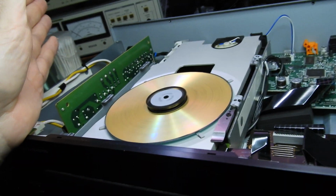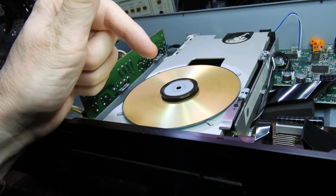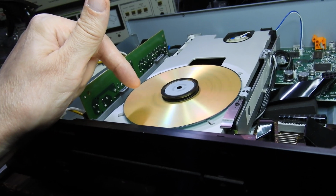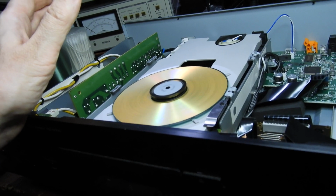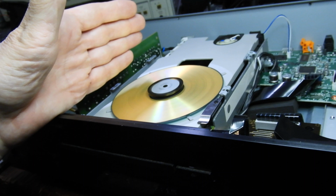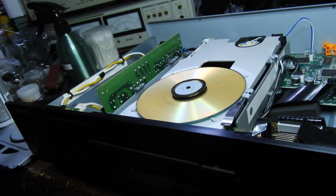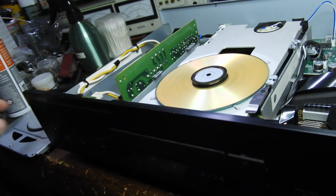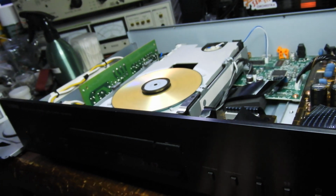It is a very good build, and it has a nice feel, and I'll show you how the tray runs at the moment. The CD actually runs faster. It runs at DVD speed, and this is my first surprise, that you can make a CD player with old school Sanyo mechanism, to be driven by the modern servo board. It actually spins much faster. One learns things every day. The puck is there just put on manually because it normally sits inside of all that, and I suppose that is to reduce the noise from this fast spinning drive.